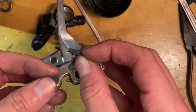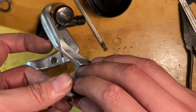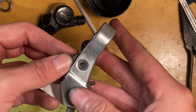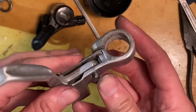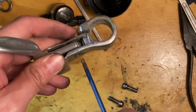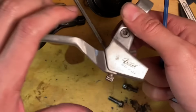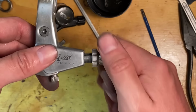So just reassembling the levers back together now. I did polish up both of the lever assemblies, just mildly with some Autosol, and then cleaned some parts of it before putting it back together. And then reassembling it with the bolts that had been treated with Evaporust. I did put some Penetrol on them afterwards as well, because otherwise they can slowly reform that rust.